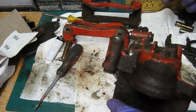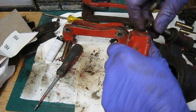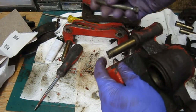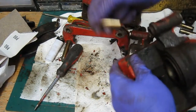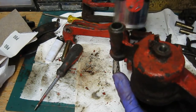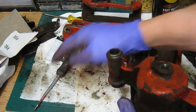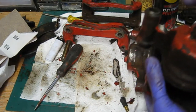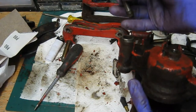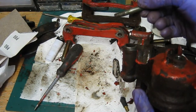So that's probably about an hour gone by since the last bit of video. The main slider in there was completely seized, and the pin was seized as well. I had to take the actual dust cup off the top, soak it with penetrating fluid, and then knock it through with an old screwdriver and a hammer. It's actually coming out now. The pin's slightly bent — you can see that — so I'm going to see if I can straighten that out and re-tap it. If I can't, I'm going to see if I can source a new one.